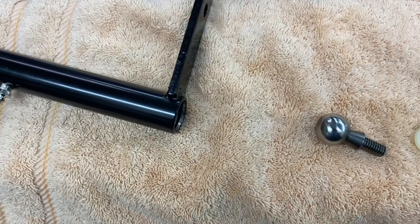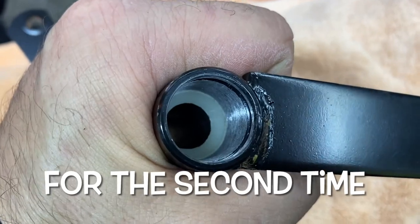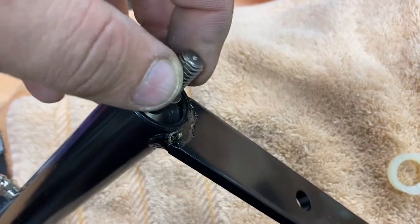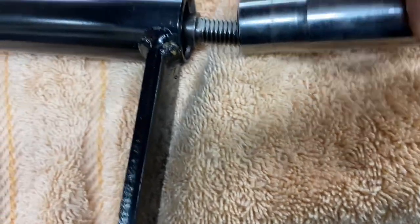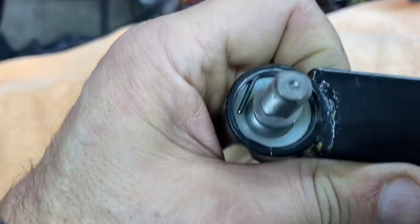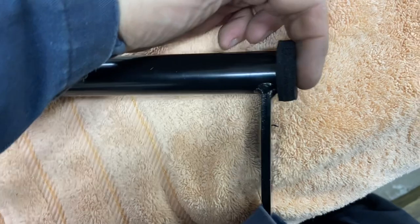Reproduction parts - yes, they're available and you can get them, but you gotta make them work. Now let's assemble this. We push one bushing in with a socket, the ball goes in, the other piece slides in, then use the socket to push the other bushing in. We get the little clip in with a screwdriver, and then the felt washer goes here against the bracket on the car, and then the nut and washer.